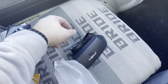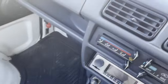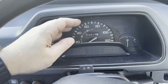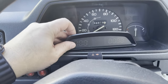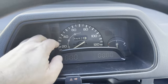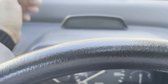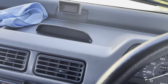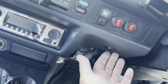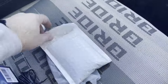It's powered via a USB cord running at around five volts. I'm going to try to hide the wiring with no visible cords. I'm debating where to install it — originally I was going to put it here, but it obstructs too much of the gauge cluster. Up on the dash is right in the line of sight with the steering wheel, so that's not ideal either. To wire this up, I have a USB plug I installed here, and I also bought a 12-volt to 5-volt adapter.